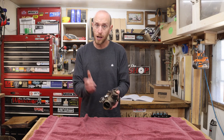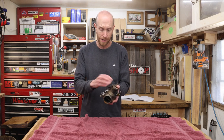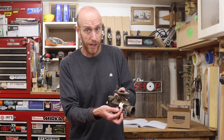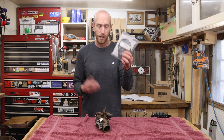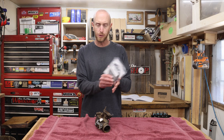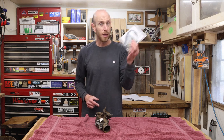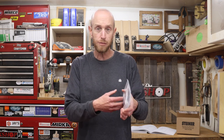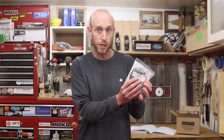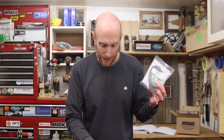Now we're ready to start tearing this thing apart, cleaning it up, and putting it all back together. But before you do that, if you're working on a project like this, you need to make sure you have the proper replacement parts on hand. There are hundreds of different models of this carburetor. Hopefully your carburetor has the identification tag still intact — this one, thankfully, does. It has all the numbers on there that I need to order up the replacement kit, which I have right here. I ordered my kit from Steiner Tractor — not a sponsor or anything, but sometimes it's helpful to know where you get parts from. I used the numbers off the carburetor to look up the part numbers for this kit. This is what they're calling their economy kit. I know for a fact that this tractor runs pretty good as is, so I didn't really need to go with the full, all-parts-included kit. I'm mainly concerned with replacing the gaskets, and that's mostly what this is, along with a couple other pieces we will use.